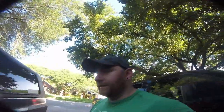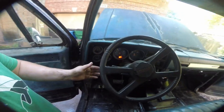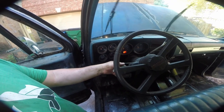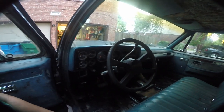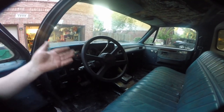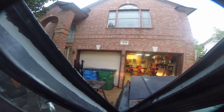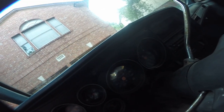Pretty much the only two items remaining are building the exhaust - I can't pass inspection with open headers - and I can't get the high beams to work. I got the entire steering column apart only to realize that the column itself is not fixable, so I spent an extra hour reassembling everything. Then I figured out that down here there's a little joint that controls the lights. If we turn the lights on the low beams are on, turn the high beams on the high beams come on. You can see the flash and more importantly in the gauge cluster - high beam, low beam, high beam, low beam.